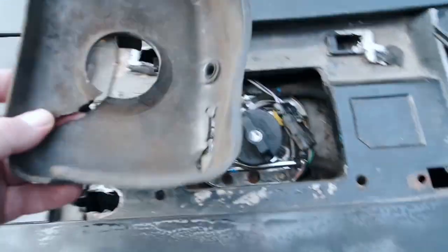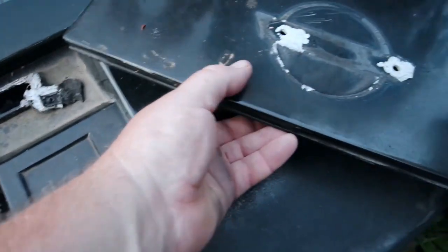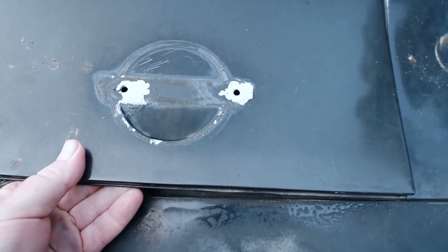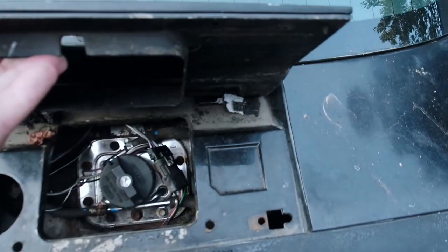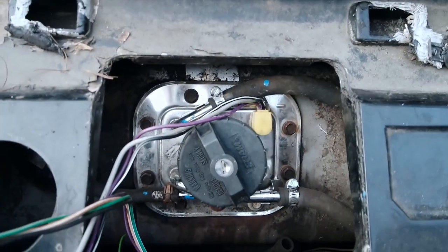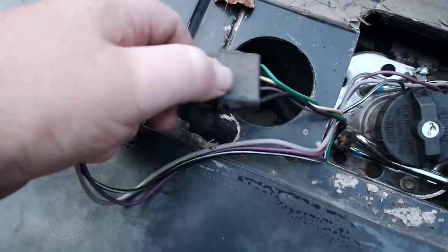When I came to look at the fuel pump, this had already been messed with by someone. As you can see, they busted the fuel door and tried to take it apart and didn't do a very good job. What it's supposed to look like is kind of like that — then you lift this up, take a couple bolts out, and you can get this guy out, which gets you to the top of the gas tank and the fuel pump. The fuel pump wiring is right here and it looks like they may have replaced the fuel pump at one point.